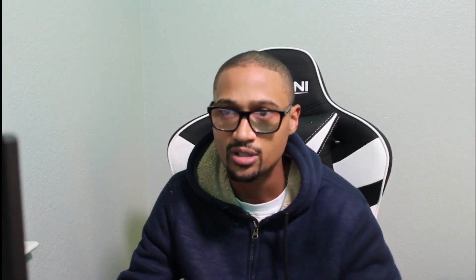For reference, 32 degrees Fahrenheit is 0 degrees Celsius, which is the freezing point — keep that in mind when we go over these numbers. We have a Mustang Mach-E Select, the rear-wheel drive version. During a normal month we have 230 miles of range, and during this winter month the lowest I saw was 166 miles. That equates to about a 28% loss in range — not necessarily battery capacity, but range, because that capacity is being used by other things.